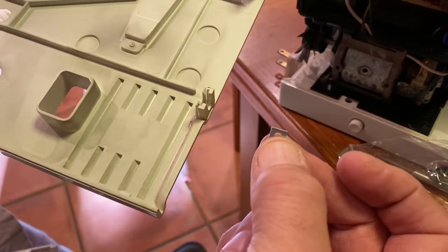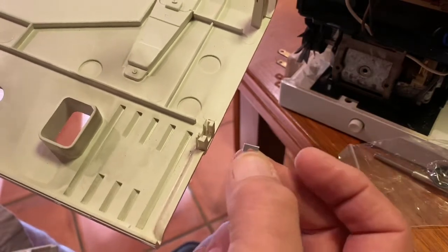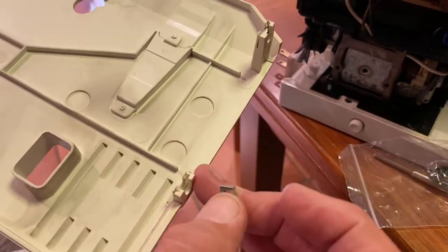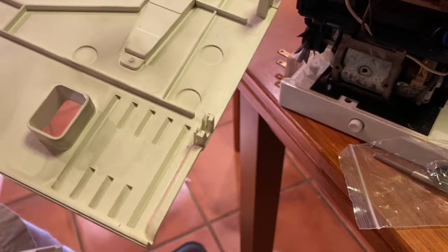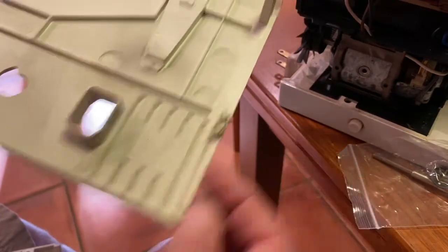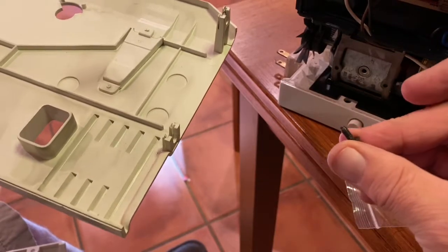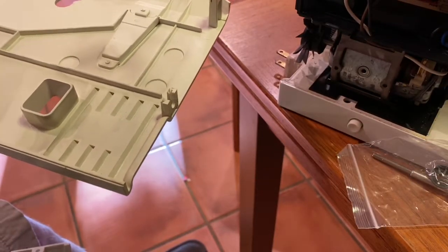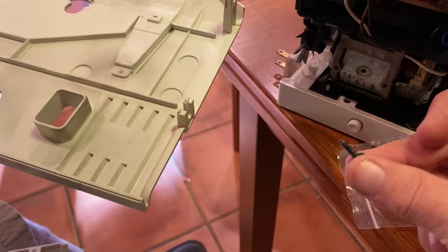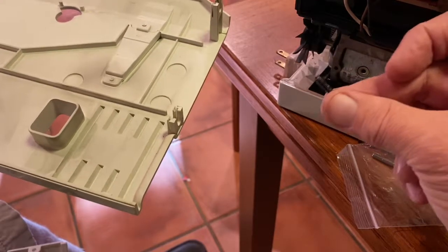Removing the panels — I'm not going to cover it — but there are three screws coming in from the bottom: two into this side, one here, and then one into the back of the machine. They aren't the same length. The ones from the bottom — this is the short one, and there are two short ones, and then there's this longer one. The longer one goes into the bottom hole closest to the front of the machine.